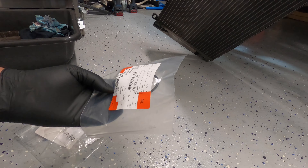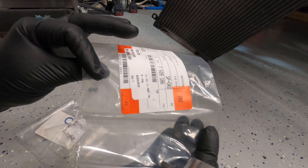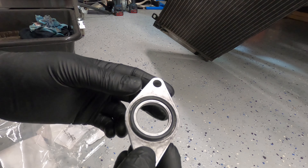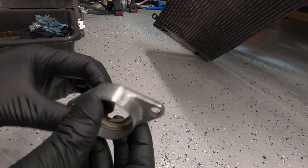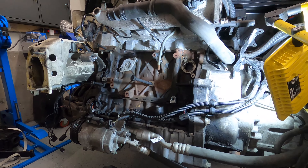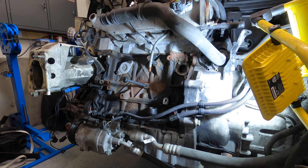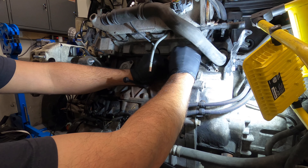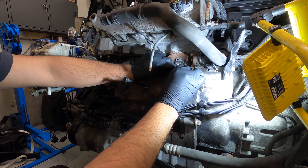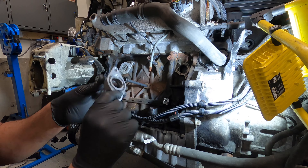My washers and O-rings have finally showed up, so now we're going to put the flange, the water pump, and the supercharger all back together. This is the original Mini part — it's totally fine for it not to be flat. I also need the O-ring for the crank sensor or speed sensor, so we'll replace that one too. The Mini has been down for over a week, which was supposed to be a quick project but turned into a longer one — from changing the clutch to every single seal that leaks and servicing the supercharger. Just clean the surface as much as possible and the mating surface has to be smooth so the seal sits on properly.